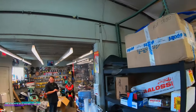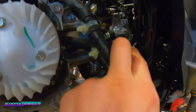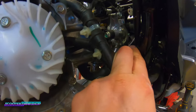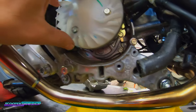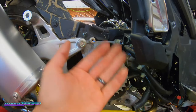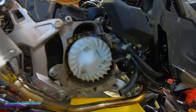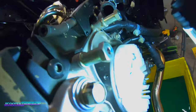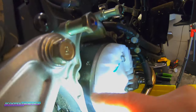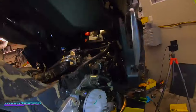I'm on the fence of whether I want to tear this whole bike apart because I can theoretically get to the cam from here. I may just go ahead and take it off. We're going to set this at TDC — got the radiator off and got it drained. We're going to set this at top dead center and then start to pull the valve train apart and see if we can get to it this way. You're looking for a line right here on your flywheel to line up with this tab here.